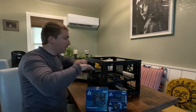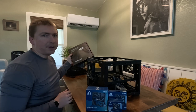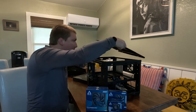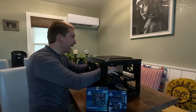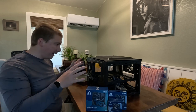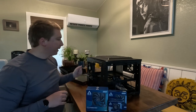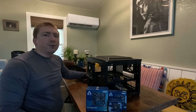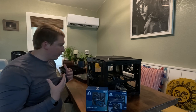The fans on the front are going to pull air into the central space where the motherboard, CPU, and GPU will live. The rear fan, rather than exhausting as is typical, I'm going to set up so it's blowing air into the case. So we've got three fans that can pull air in, and then the Noctua - which I have to mount in push configuration - will sit on the bottom of the mesh screen and push air out up through the top of the case. As components get hot and reject heat, that heat will naturally rise up through the mesh grate.